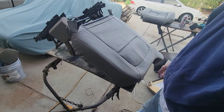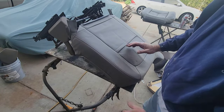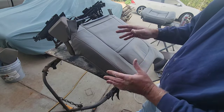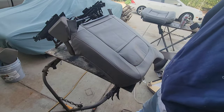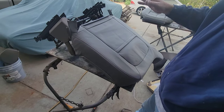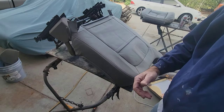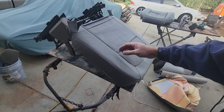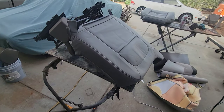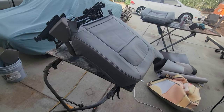But you know, some other videos guys show they're going in the middle. Maybe that's their seat covers, the ones that fit looser, which I don't want. I don't want the loosey-goosey wrinkly seat covers. I want nice tight ones. And I'll get that other one a little tighter. On the bottom edge, I'm going to use some hog rings just to hold it, because maybe this plastic stuff isn't as good, so I might just use a couple hog rings on there, kind of the way we do seat covers before we have these modern cars.